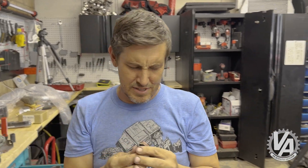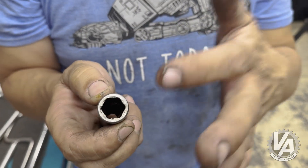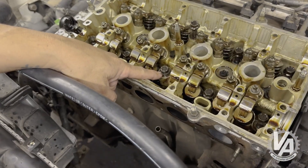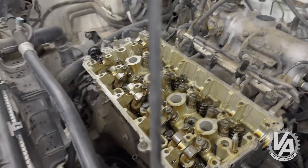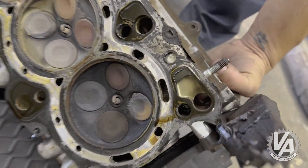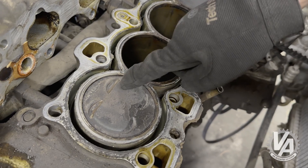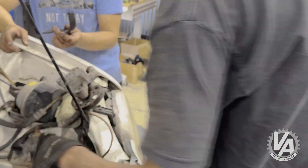So what's up? We have a stripped head bolt, but I feel part of it may have been because this 14mm socket is very, very used — you can see it's not really flat in the flat areas. I could grind that down, but there's not a whole lot there to get to new meat, and that bolt is very unhappy now. Any time we apply pressure, it just pops up. One step closer to a K-swap — the burnt valve. It happens to be on the one that's missing the nut. That valve is like gone. In breaking the timing belt, those valves hit the piston on number four. They actually don't really look bent, but if we have a replacement head we'll just replace it. You can see the marks on the piston from the valve hitting it. The belt is now in multiple pieces.